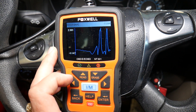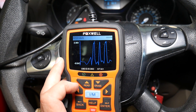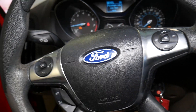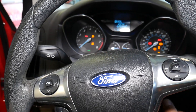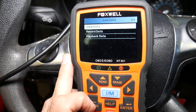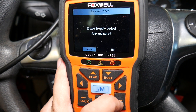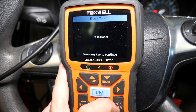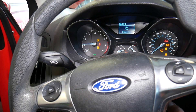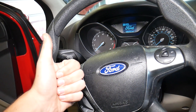This is a good working sensor: when you rev the car up it needs to go up, and when you let off the throttle it needs to go down. From that point, we can turn the car off, go back, and clear the codes by clicking Erase Code. If we start the car again, we shouldn't have the light on — and perfect, the light is off. That's how you do it. Thank you for watching, please subscribe to the channel for more videos, and see you guys next time.